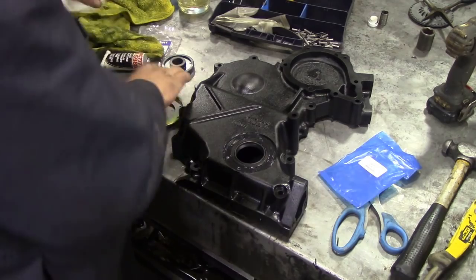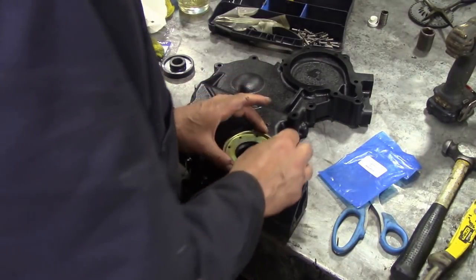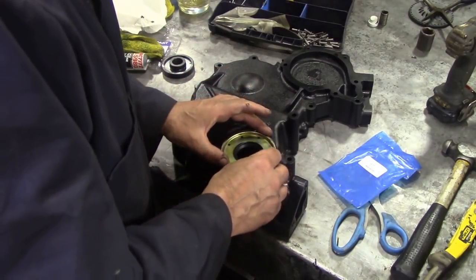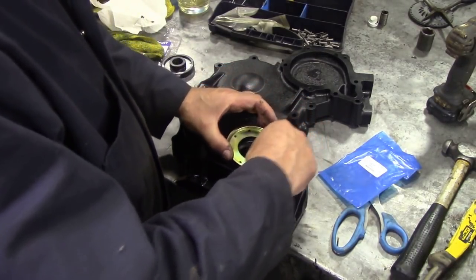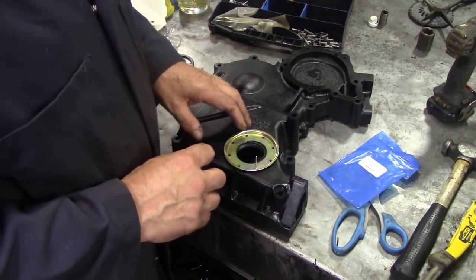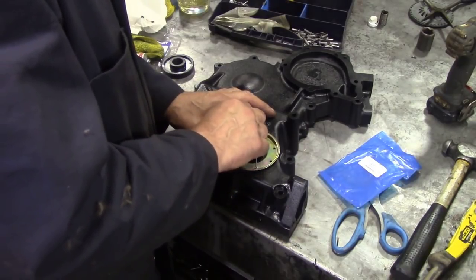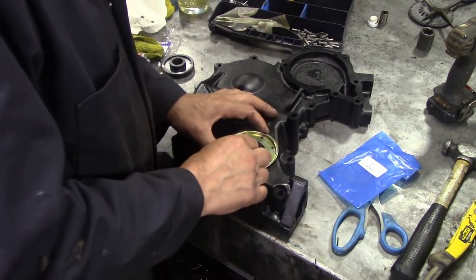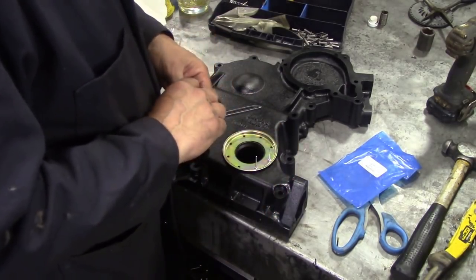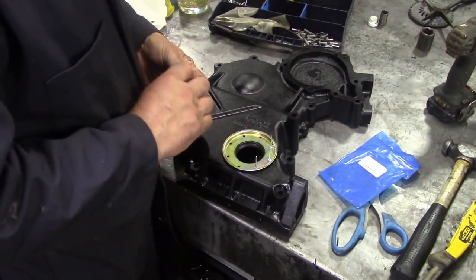So what we'll do, we'll put the ring on, and we'll try and locate some original, not that one, these ones here. We'll try and locate the original holes, like that, and we'll put quite a few in that we can get in, and then we might have to just do a different size seal, different size pop rivet. It's really frustrating, but we'll get there. That's if the holes all line up. Some of them are a nice tight fit with a 1/8 rivet in.